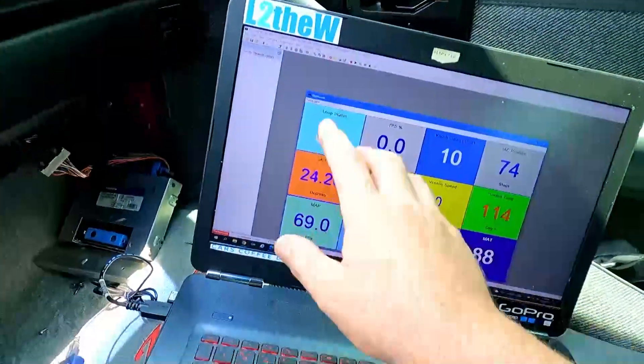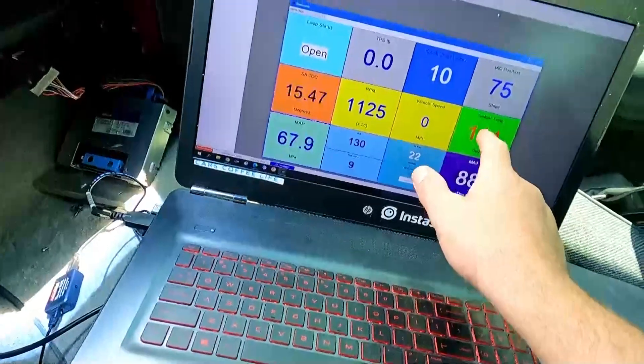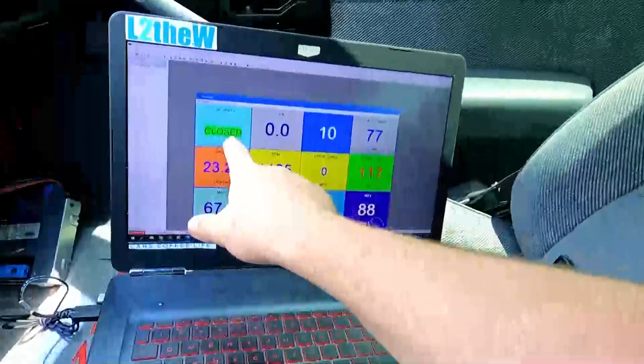Me and Brian are on the same page now. What we're tuning the car for is drivability — it's getting extremely lean just on relatively regular driving. So what we're looking at this time is just the condition of the fueling while we drive. We'll wait for this to say closed loop — that means it's up to temperature. We're only at 114. We'll go closed loop and then go for a drive.